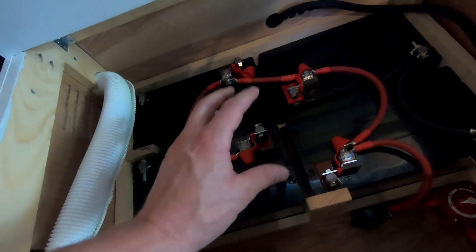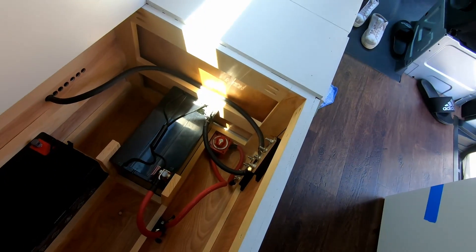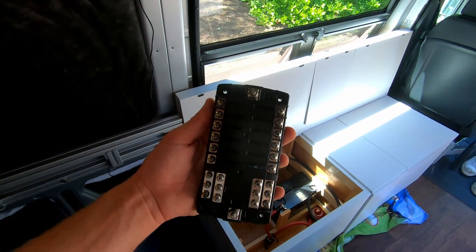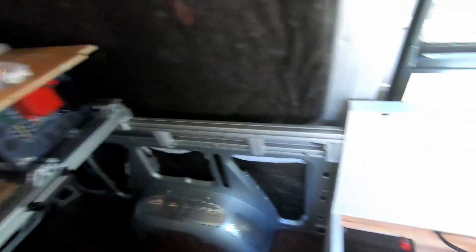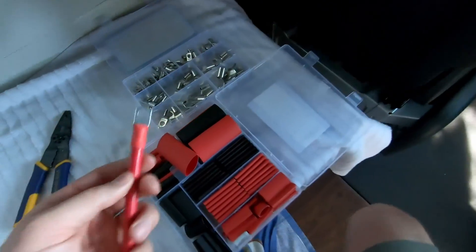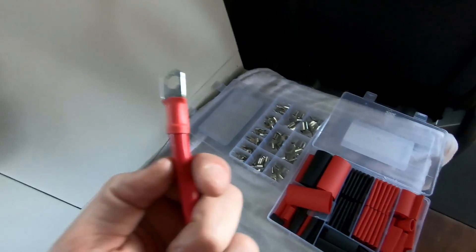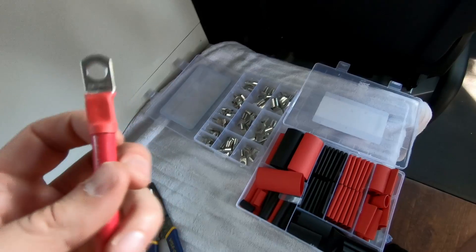This whole battery bank in parallel goes directly from the battery bank to a 200 amp breaker into a switch and then onto the positive bus bar. It's now time to move on to the first couple of auxiliary components. For me that's going to be this Blue Sea 12 volt fuse box. I'm going to put this somewhere about right here, and that's where all my 12 volt components are going to connect. In order to get my 12 volt fuse panel installed I had to use this 4 gauge wire which I bought in a spool. Since it didn't come with connectors, I had to crimp the ends of the wire myself with lugs and then heat shrink them — it's actually pretty easy to do.